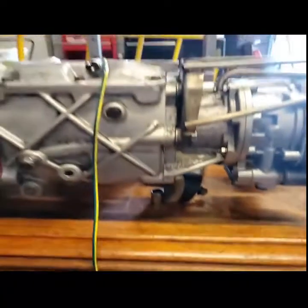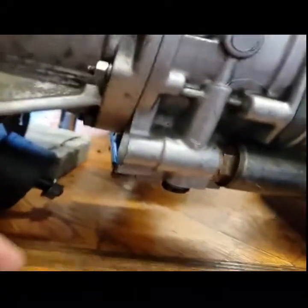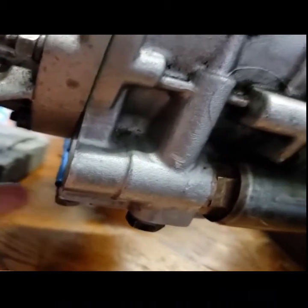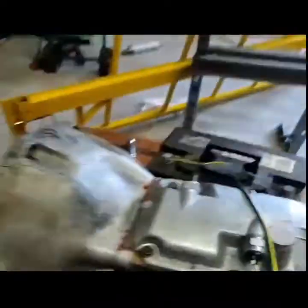I've seen two spots. This drain plug was leaking, so I cleaned it up real quick. And whenever I tighten down my service door from my overdrive right here, I tightened it down with a bunch of fluid on it, so it looks like all that got pushed on out. I wiped it back down and I'll check it again tomorrow. At the moment I'm not too worried.